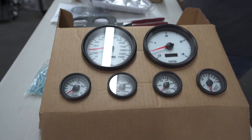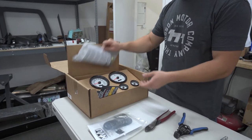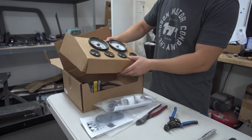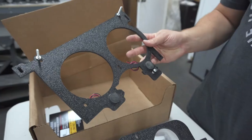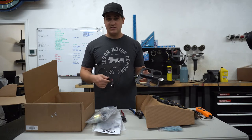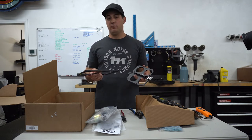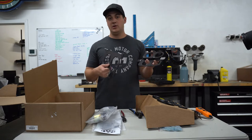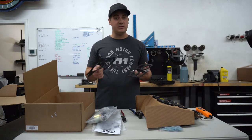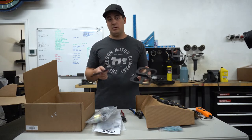You can see our gauges — they look great, really nice. Also included in the box, we have some install rings, all of our wiring and our sending units. And if we remove the gauge cluster, we have our mounting bezels. Something nice about the new vintage systems is that in most of their systems, this mounting bezel will replace the entirety of your old factory bezels. So you don't have to go and reuse your old nasty plastics — this will all bolt into your dash in the vast majority of their applications.